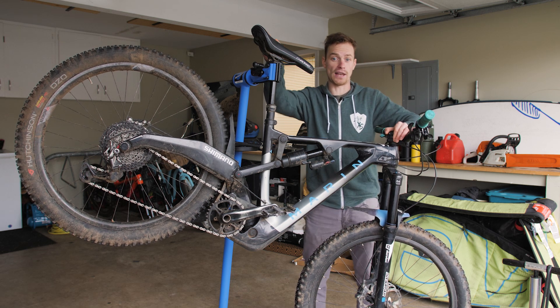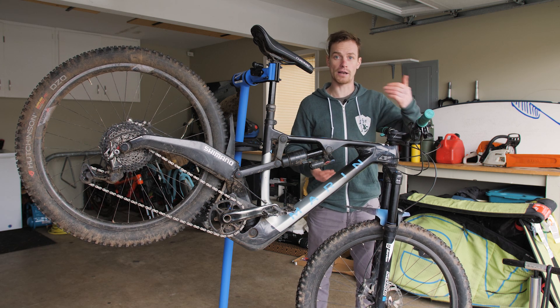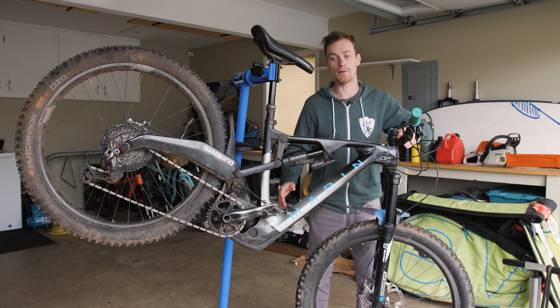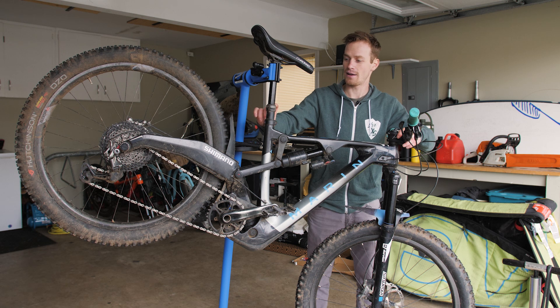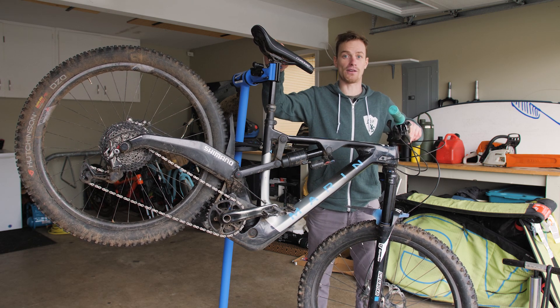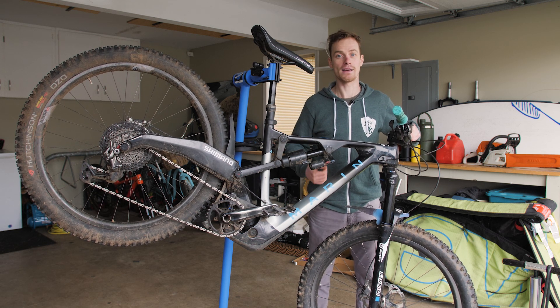The final thing is saddle height. The bike shop will set it up so that with your dropper or seat post at its highest, your knees are in the right spot for pedaling and climbing. But where you want the saddle when descending is personal preference. Coming from a dirt jump and freeride background, I like my seat as slammed down as possible — only about two inches of space between the seat post clamp and the dropper stanchion. This keeps the seat completely out of the way for tricks and aggressive steep terrain, so it never interferes when you're getting your weight back.